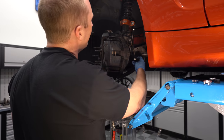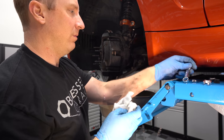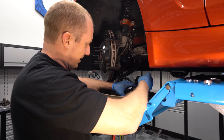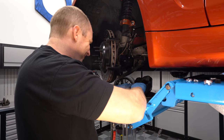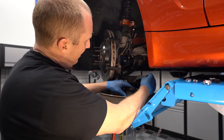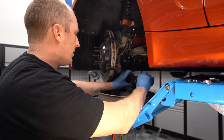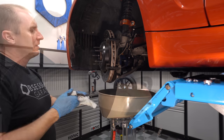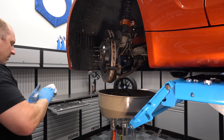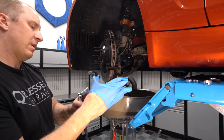I'd rather not drain all the brake fluid — I can just turn this up and stick it somewhere so I don't lose a lot of fluid. Don't run the lines dry. It's also smart to have paper towels handy. Push the caliper or brake pad in to squeeze out your fluid. That's what a single piston looks like — we're going from one piston to six, it's got to be better. Now I'm going to take these two bolts — they're going to be torqued to probably 110 foot-pounds — these are 16mm bolts that hold the caliper bracket on.